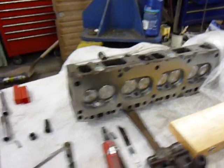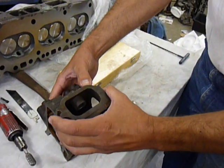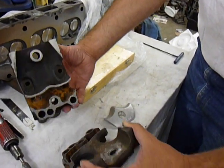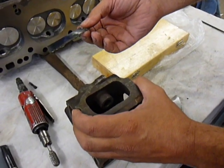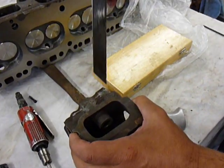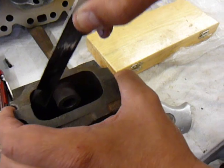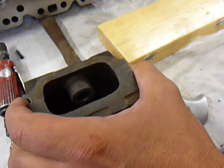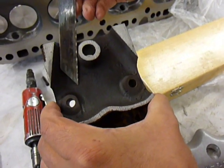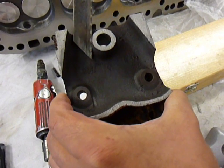Now, to go through a few steps to install these — the first thing you'll need is your stock head. What I have here is a head that I've cut up in pieces, a breakaway. The first tool you'll need is a hacksaw. I like to use a Milwaukee Sawzall with a metal blade. I like to cut that bolt boss out of there — simply take the Sawzall and cut in this manner, completely through that bolt boss, doing the same thing to the bottom side, and then you'll have a plug fall out. Be careful when cutting through it: take the Sawzall blade and do not go in so far that you're hitting near the valve guide area. You only need to go through this area here, and just let it guide along and you'll cut that out.